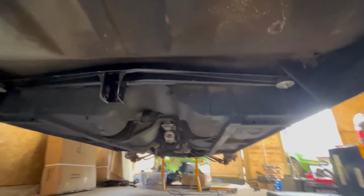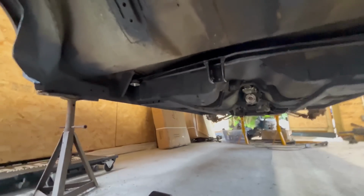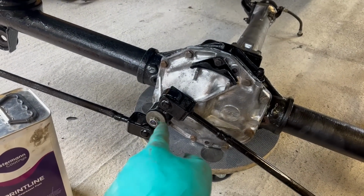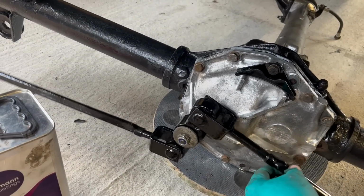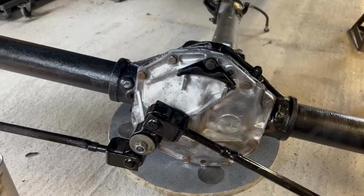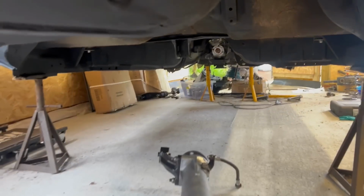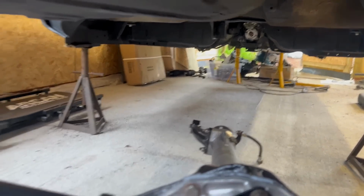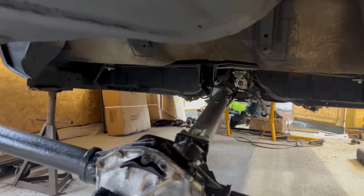Okay, cross beam is in. It's not done up because I'll probably do everything up at the end, same as this isn't done up either, because that needs to be free to rotate to help everything line up and centralize. But now I can slide the axle forward, lift the nose up, engage it in there, fit the insulating washers and the bolt, and then we're ready to play with dampers and things. That's up and in there, again all loosely fitted.